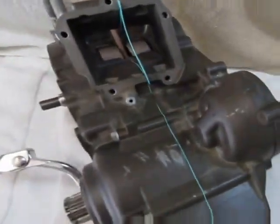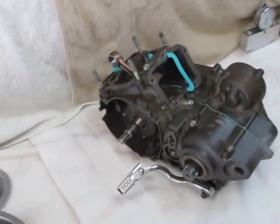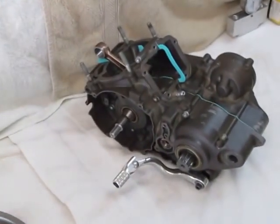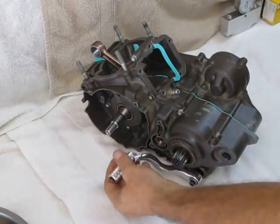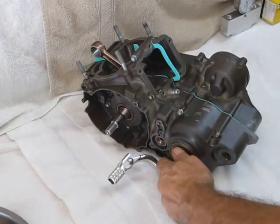It's a little bit tricky. Occasionally you'll see on KTM Talk someone will say, 'Hey, I just put my engine together but I can't get it to shift on the workbench.' Well, nine times out of ten they put it together right, but it is just a little bit tricky. What you've got to do is operate the shift lever, hold the counter shaft, and rotate the main shaft back and forth.